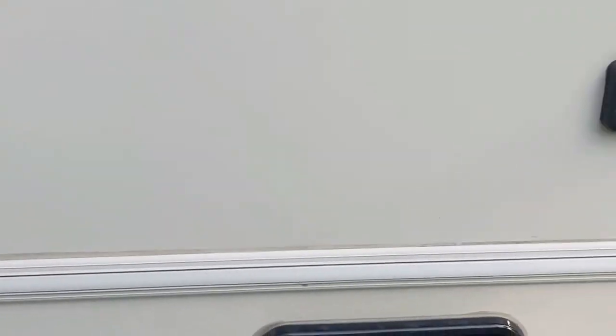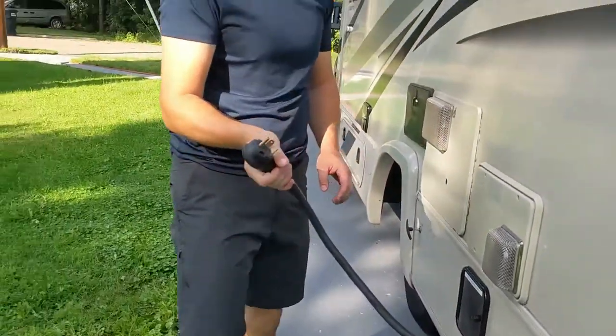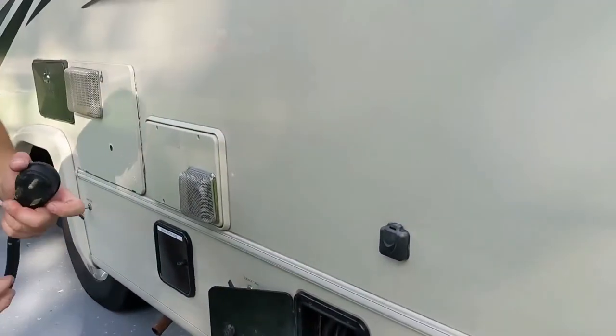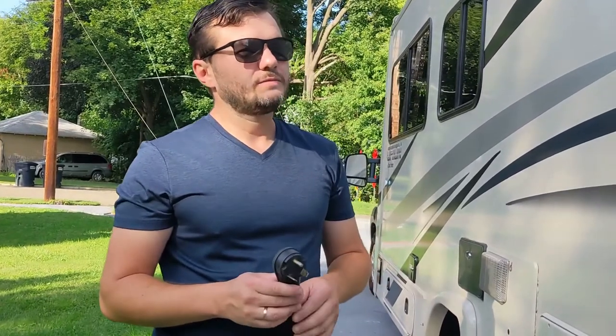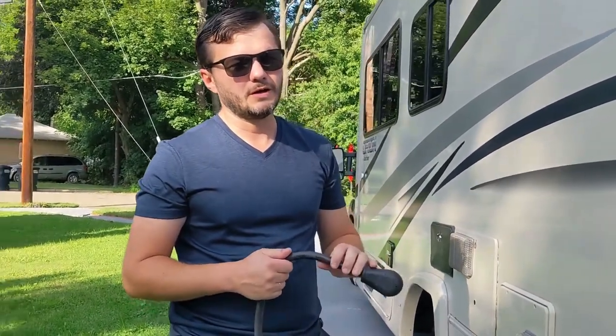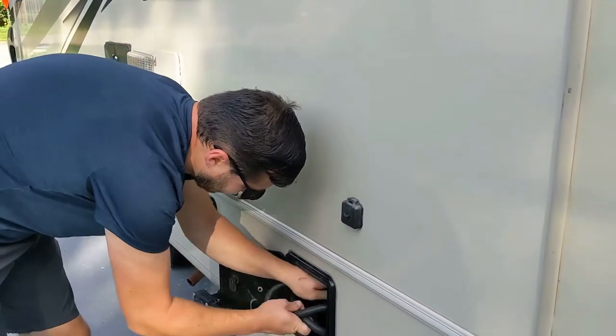Shore power is straightforward: you have an electrical cable that's 30-amp service. You plug it into the post, turn on the breakers, and you're all set. Inside there's also a little adapter if you want to connect to a 110 outlet — say you're parked by a house that doesn't have 30-amp. You can use a regular extension cord and connect to a regular outlet. However, when connected to a regular outlet it's only 15 amps, so most likely the air conditioner won't work and it will probably trip that outlet.